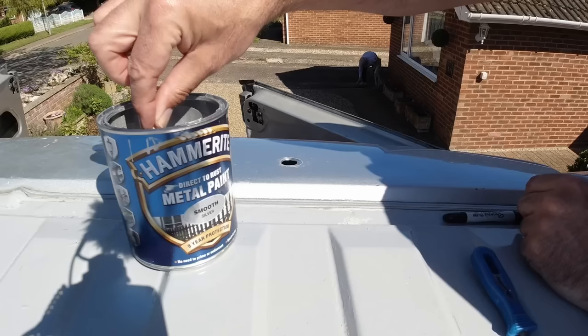So he's got a little sort of T-slot cut in this little channel here. This slides over that little T-bolt like that. There's another bit of folded stainless with these protective rubber strips on. Drops down over the top of the bolts onto the roof, and then you can put your Unistrut or your roof rack, whatever you want to do, Unistrut across the van to put your solar panels on.